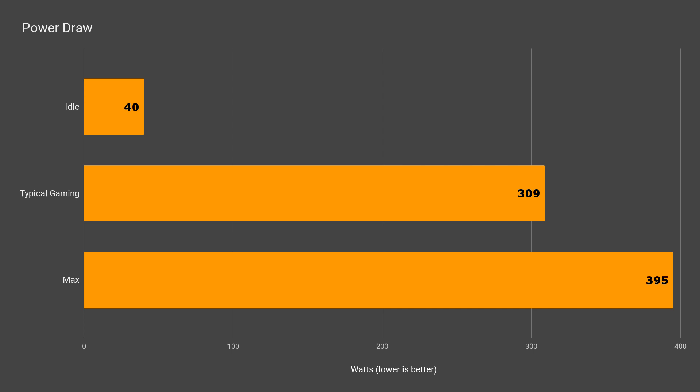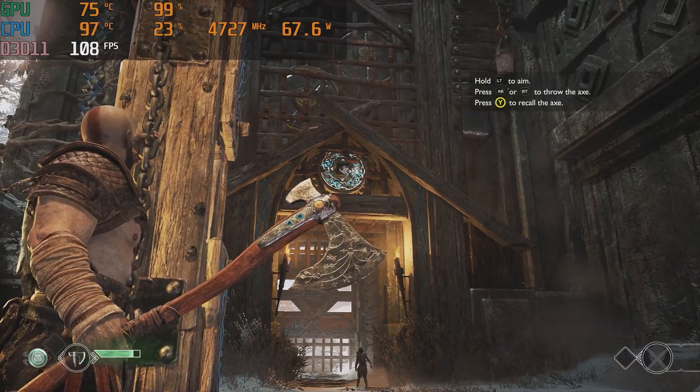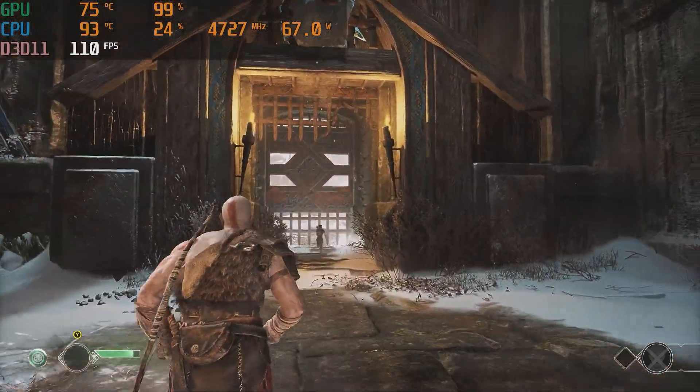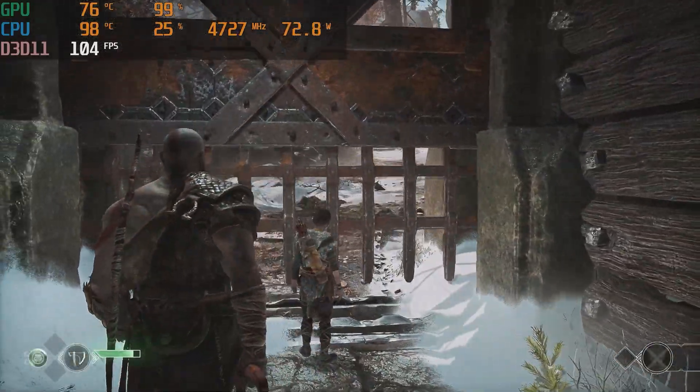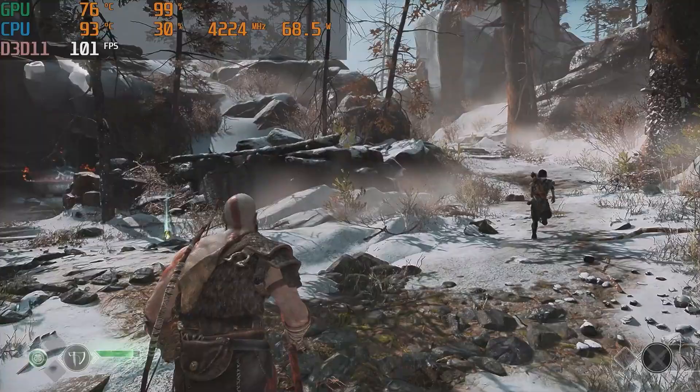So that's the fun stuff out of the way. Power draw topped out at 395 watts from the wall, which doesn't upset the 500-watt power supply at all. With 80% rated efficiency, you'd be looking at 600 watts drawn from the wall to deliver 500 watts of power to the DeskMeet. I think a 3060 Ti, which adds an extra 50 watts to the total, is fine. CPU temp hit 100°C at 21°C ambient when the CPU briefly turbo boosted - not surprising with the stock cooler. The graphics card topped out at 77°C, which isn't too bad.